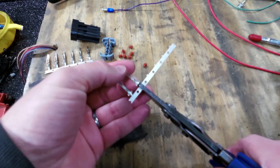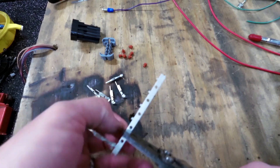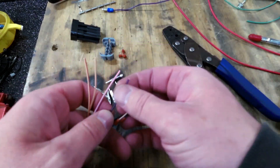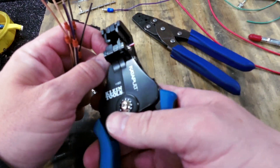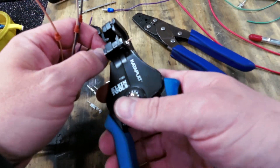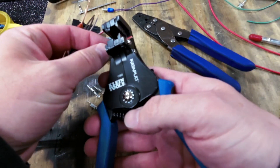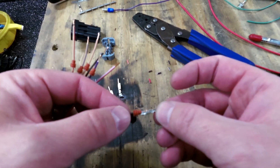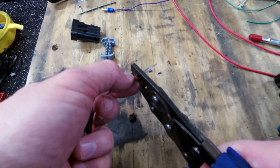Let's get into the assembly. We're going to start by breaking off the pins from the strip — just use the tip of the crimpers to do this, it works pretty well. Next we're going to put the seals on. I put the seals on before I strip the wire; it just makes the seals go on a lot easier. Then we strip the wire — you don't need to strip a whole lot off, probably a little less than a quarter inch. Take a look at the pins and sockets to see what you need. One thing I don't do is twist the wire — just leave it in strands. Then we slide the seal up to the end of the wire, make sure the wire is in the body of the terminal, crimp that down, and then crimp the seal.